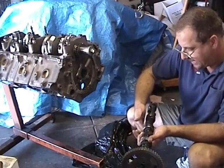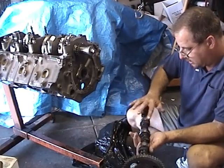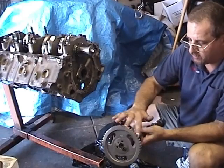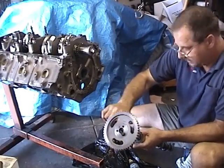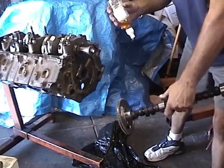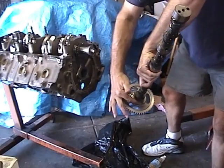It's very important to lubricate this because the first time you start it, the engine is going to be starving for oil pressure, especially around these cam lobes. We're going to oil prime this engine before we get it going, but that mostly lubricates the crankshaft and crankshaft bearings — not really much on the cam. Also put a little bit on the back side of your timing gear. Your timing gear has a little thrust area which runs against the block and you need to oil that part too.